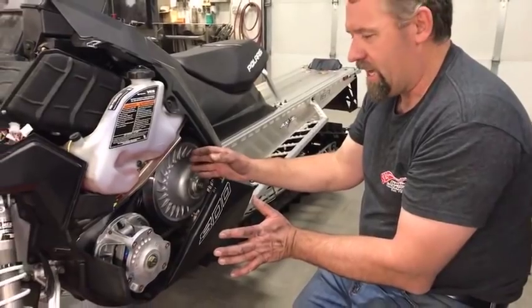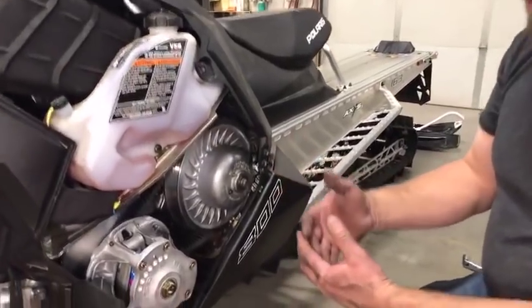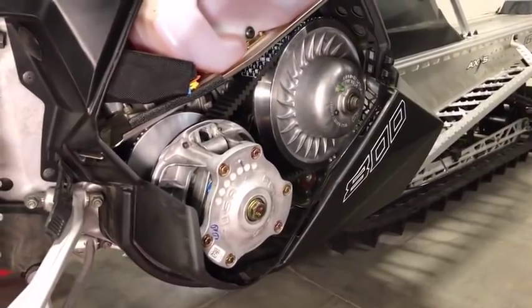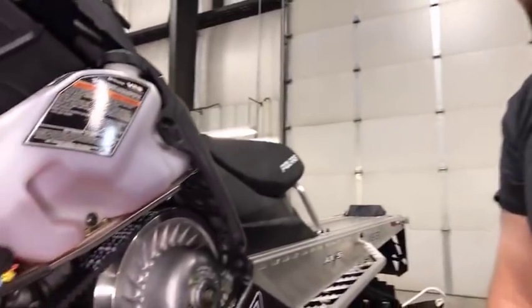Your weights are out of position via the roller, so it's not as effective at transferring horsepower on the low end. Your top-end speed is also reduced because at full shift-out on the drive clutch, the driven clutch still isn't shifted out all the way. What we just did probably gained us somewhere in the five to seven mile-per-hour range on top-end speed, simply from correcting the shift ratio.